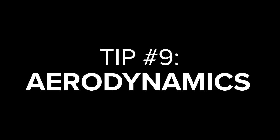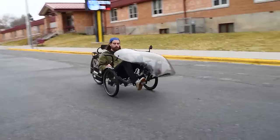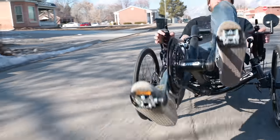Tip number nine: aerodynamics. Once you get to the point where you're consistently riding in the 20 mile an hour range, you'll find that the biggest obstacle is air. Even though most recumbent trikes sit low and have an aerodynamic advantage, you'll still feel air pushing against you at high speeds. If you're a fast rider and looking for another advantage, adding a fairing on the front of your trike can give you a pretty good bump. In our testing, a rider that averages 18 miles an hour and faster that adds a fairing to their trike will see a 10 to 20% speed increase for the same pedaling effort. A fully faired velomobile trike has gone over 75 miles an hour over flat ground at the Battle Mountain races. Adding a fairing on the front of your trike gives you many of those same advantages without adding all the weight of a fully enclosed shell. Even the 75-pound velomobile can maintain a human-powered 40 miles an hour on the flat with adequate gearing.